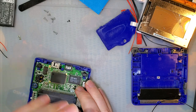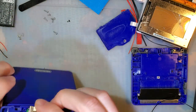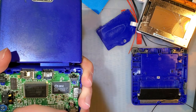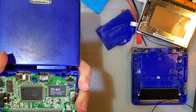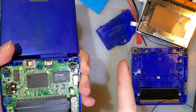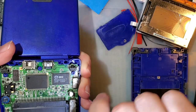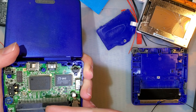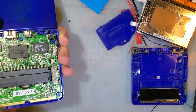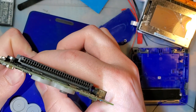So how the reverse current protection in this device, and quite a lot of devices actually, works is on the battery terminals, there is a diode connecting the two with a fuse in between them. So when power is applied normally, current can't flow across that diode and across that fuse. With current connected backwards, it's going to flow across that diode and basically trigger a dead short condition in the battery, which will put entirely too much current on the fuse, and it should trip that fuse.